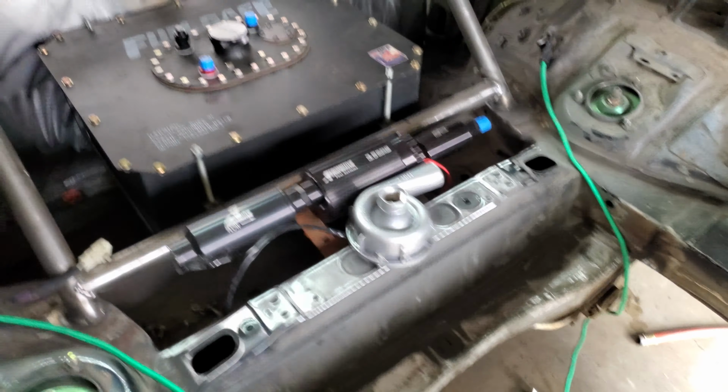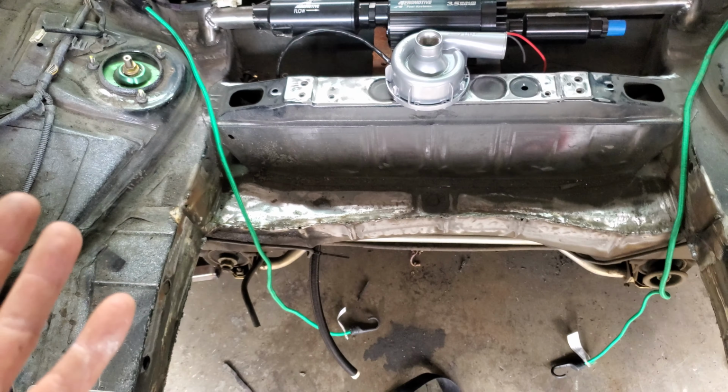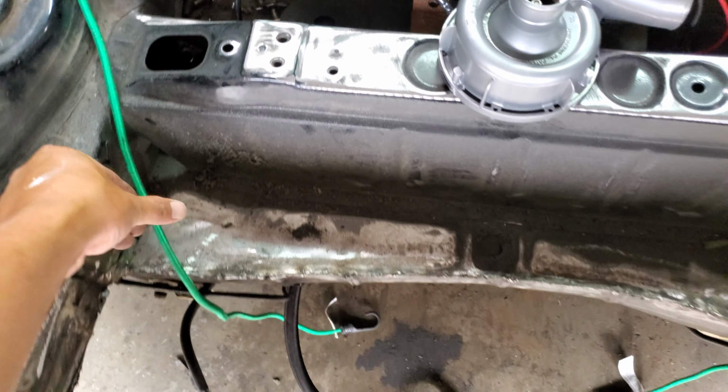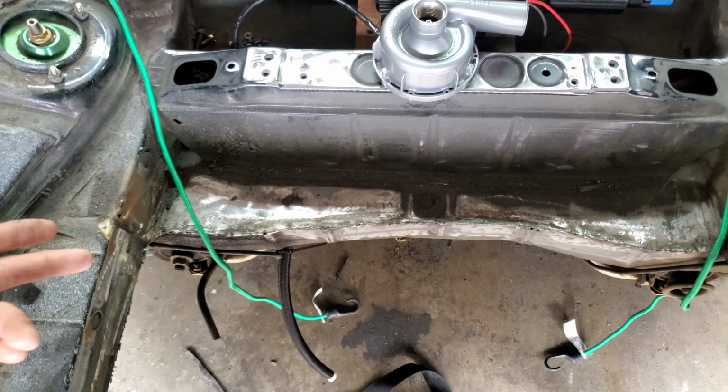Today we're working on getting the radiator done. So I was thinking of maybe a square tubing, and the square tubing can actually get bent as well. We have the die for that, so we'll just have it bent with a curve up, and then we'll weld some tabs onto the radiator and have it mounted properly.